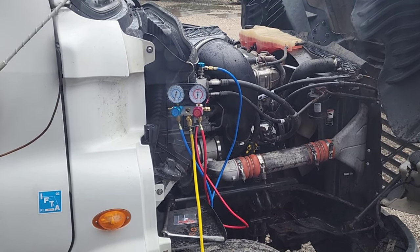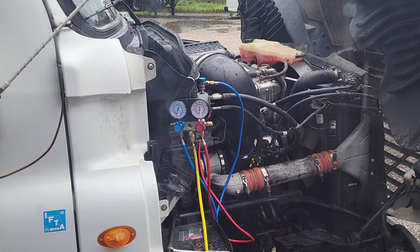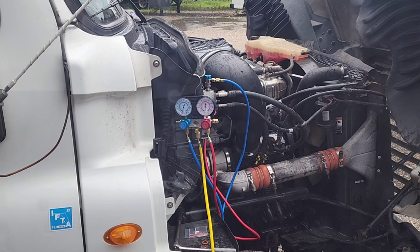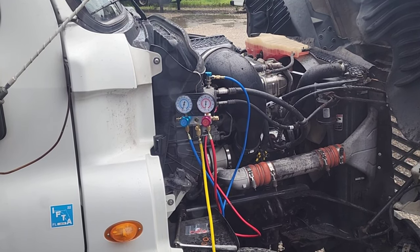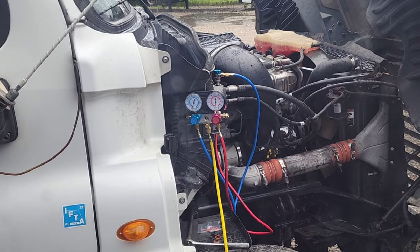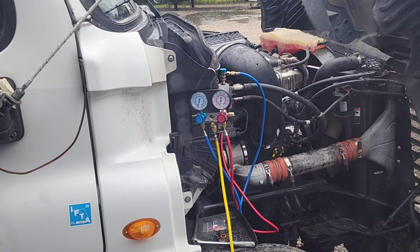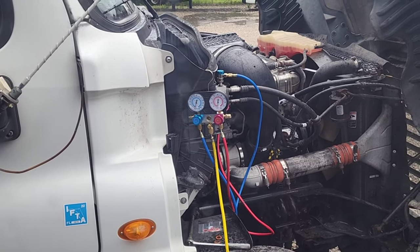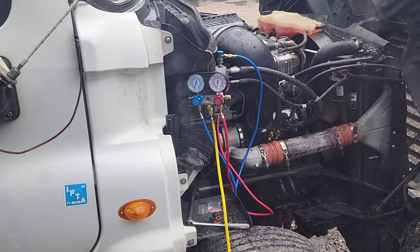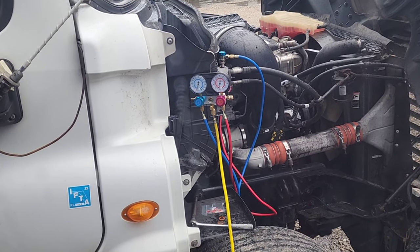It performed really good — the AC was working excellent. It's just those seals were screwed up, which was on me because I should have changed them when I did the compressor. I wasn't even there when my buddy picked it up, so it was out of sight, out of mind. Definitely change the seals on the lines where they go into the compressor. The upside is it gave me a chance to get my gauges and vacuum pump and do it the right way.